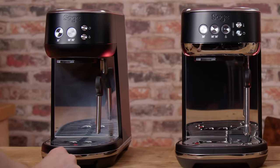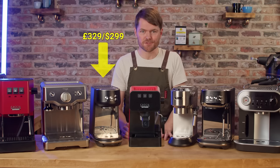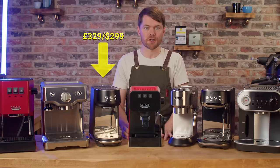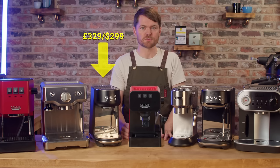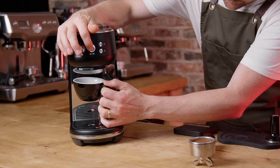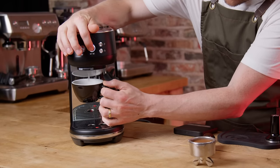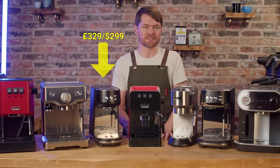It features the Sage or Breville superfast Thermojet — heats up in three seconds, steam is ready almost instantly and cools back down to shot temperature almost instantly too. It has a fixed shot temperature of 93°C/200°F, so it's not really a machine for lighter roasts, but you'll probably struggle with lighter roasts on any sub-£500 machine. Make sure you properly preheat the group and portafilter before your first shot or the consistency between the first and second shot may not be great.